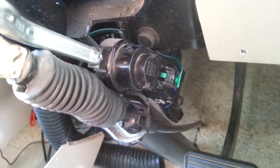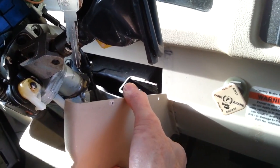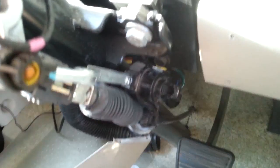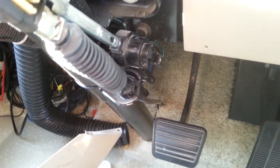Quick fix: if you're sitting there right now wanting to get going, just take this bottom cover off to gain access. You don't have to go any further than that. All you have to do is take this bottom cover off — it sits up here like this. Phillips screwdriver, a total of eight screws, four on each side. Drop that lower panel off and you should see this device here. Take your screwdriver, punch that little green piece out of the way first, then push this, and once you do that you don't even have to push the brake pedal — you can now put it in gear.